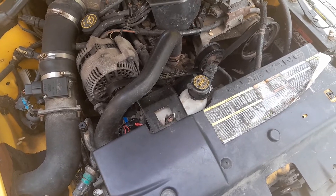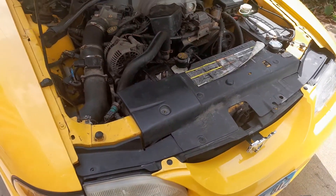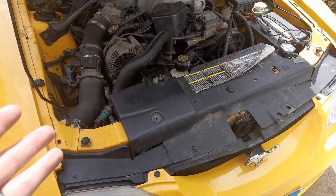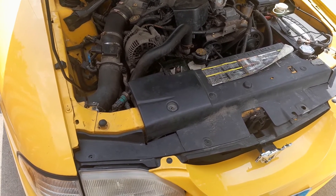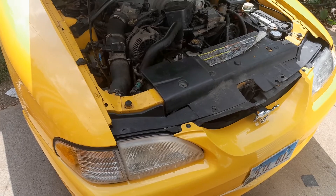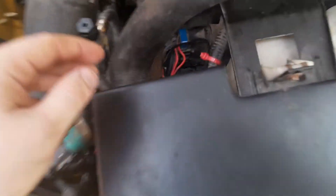The easiest way to make sure your fan is still okay, or if you're stranded on the side of the road and just need to get home, is to go ahead and turn your AC on blast. That will kick the fan to high and it'll make it run constant until you turn your AC off. So if your car is overheating and you just need to get home, you can do that and probably make it back, if it's just overheating due to the fan not kicking on.